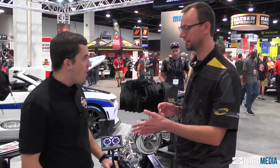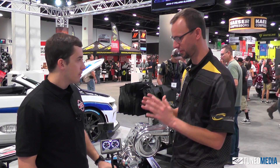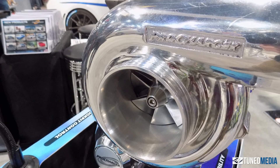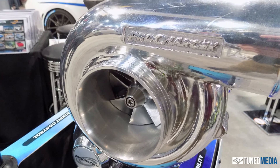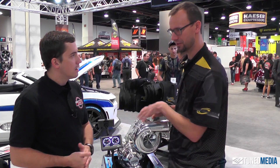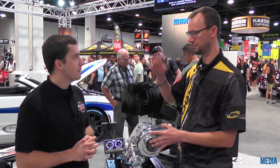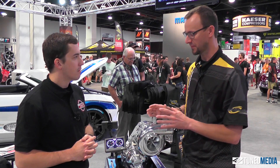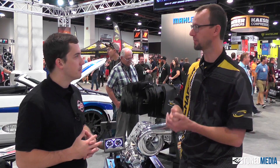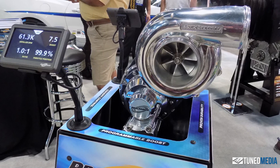Because of the complexity of the programming, it's specific to each car or truck that it goes on. So exactly how does it work? Basically you take the benefits of a centrifugal supercharger — efficiency, low charge temp, and stuff like that — and then you add a CVT gearbox onto it that we can control the internal gear ratio. So we can move the RPM of the compressor wherever we want through the rev range. The downside to having a screw blower or a roots blower is sometimes too much boost down low on a high compression motor, so you have to take a whole ton of timing out to be able to handle that.